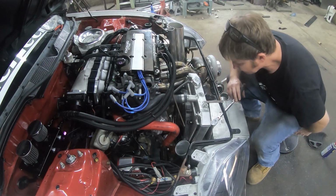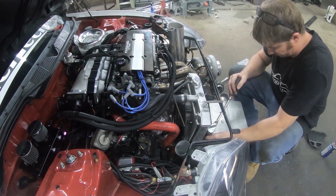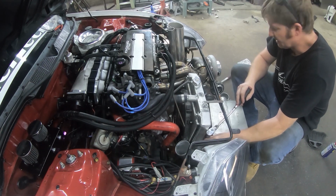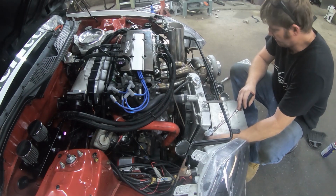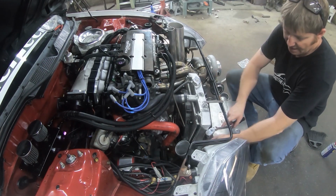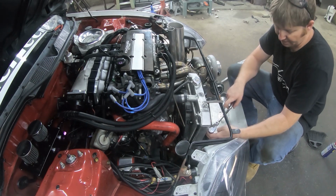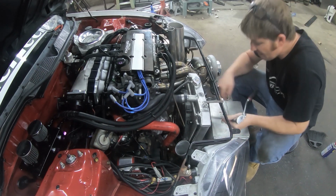Okay, well, so I've gone ahead and gotten the holes tapped in the weight plate, tested the intercooler to make sure it mounts down and looks good with the turbo. So now I actually have to pull it back off. So I need to trim off the bead rolls on the end tanks to get ready to weld on the Alpha Lock on this end. And then this side I'm gonna go ahead and cut the elbow off that goes to the boost pipe, because I'm gonna need to twist and reclock and relocate that. So I'm gonna go ahead and get this off.